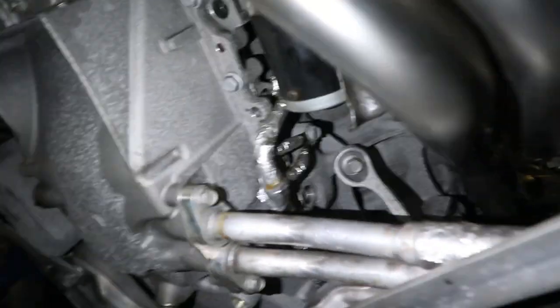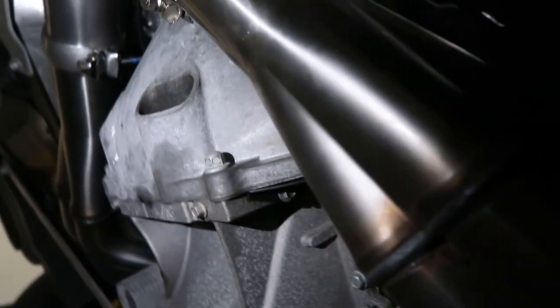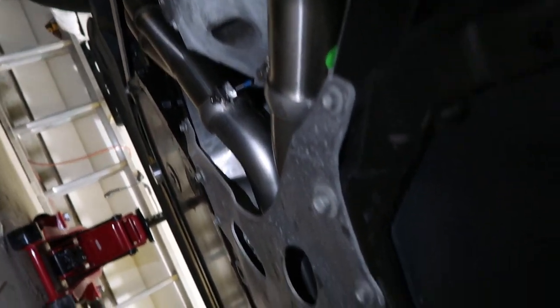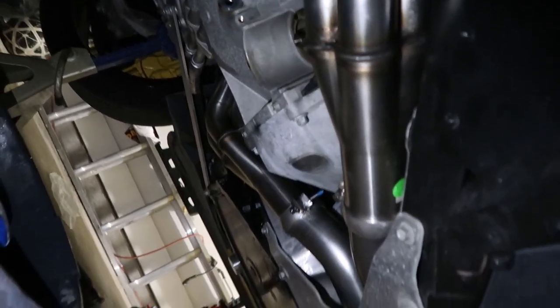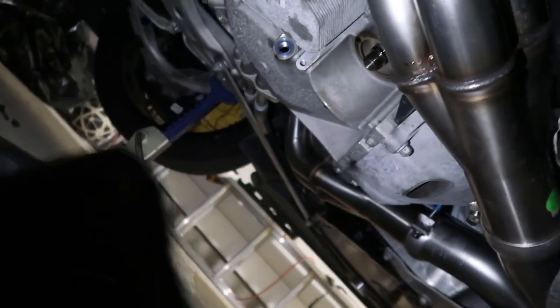The passenger side was pretty easy as well — easier than the driver side, I think. It just kind of slid in and all the headers came out pretty easy. After that you obviously want to use the clamps that come with your headers — the swivels and all the seat clamps. One tip: don't tighten it all the way because you'll have to move stuff around once you get the X-pipe on. Keep it kind of loose, because if it's all tightened up it'll be almost impossible. And then you will need to do an oil change because we removed those two lines.